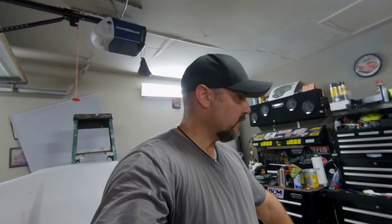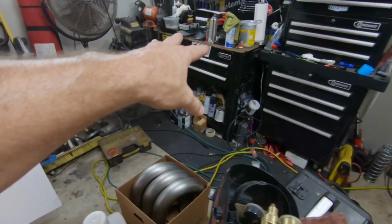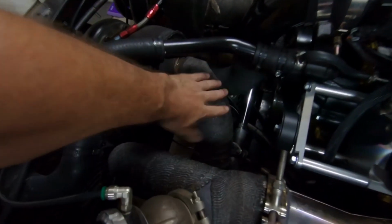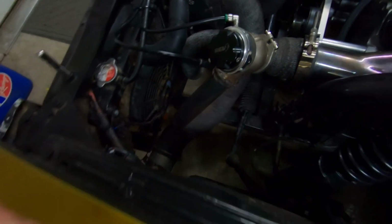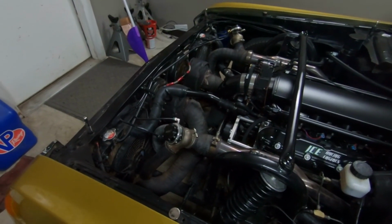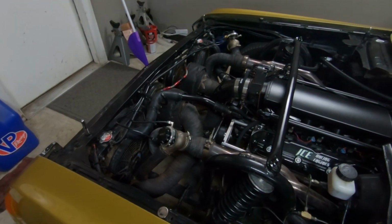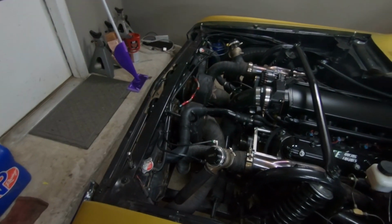The little welding right here on the exhaust is because I had a little bracket that was broken. I don't want to drive around with that bouncing around. Hence is the reason we're going to be redoing all that. I've got all the stainless right here, 3.5-inch piping, got the V-bands over there, got the new welding bungs. I'm going to be replacing all of this piping right here, all the exits to the front. We're going to be doing all of that in stainless steel. I'm going to take it over to Saxy Rod Shop, let those guys work their magic on that. They do awesome work. You've seen in other videos. Actually, in the last video, you saw how good work they do.